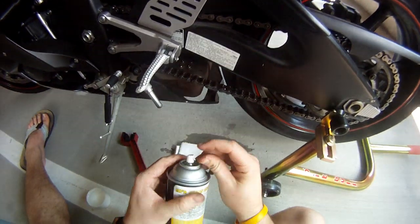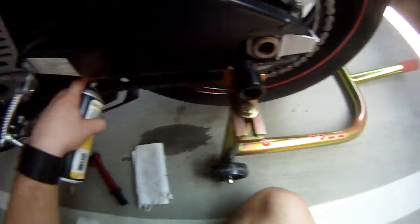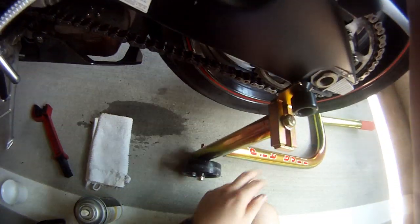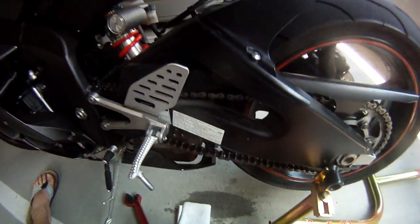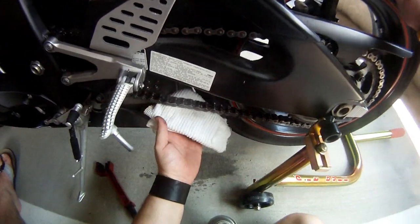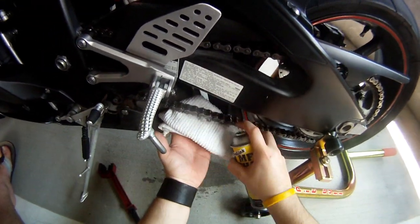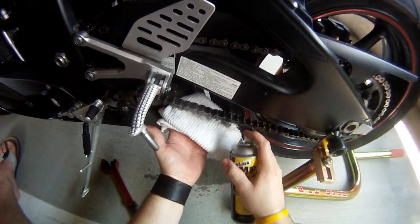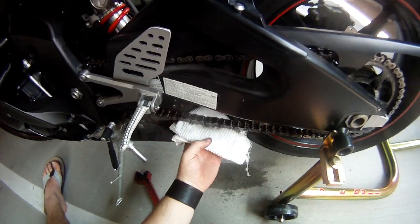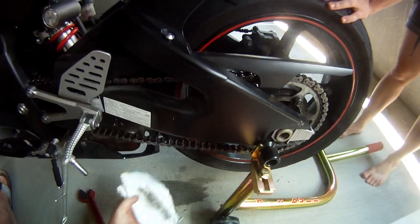I don't have a little straw nozzle for this thing, so it's kind of treacherous — I'm just going to get it really close to the chain. That's getting a little on the tire, oh well. That's all the way on the chain, and that's why you use a rear stand — because it's so much faster. If you're doing this one person, you can just get a cloth behind it, move it a few lengths, do it again, do it again. Ideally you'd have somebody helping you — they could spin the tire and you could hold the cloth with one hand and spray with the other. But if you're one person, you just have to spend a little more time doing it one by one. Here's a demonstration of if you have somebody helping you — a.k.a. my girlfriend.